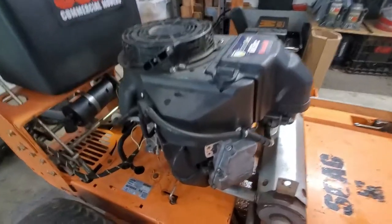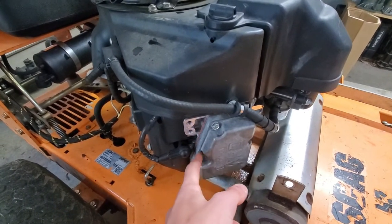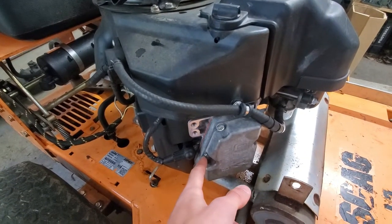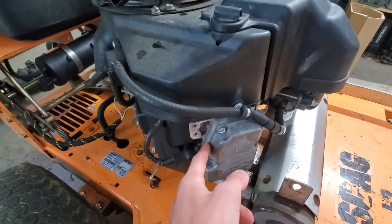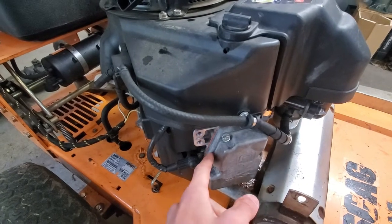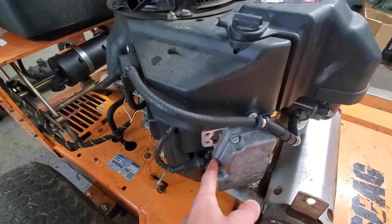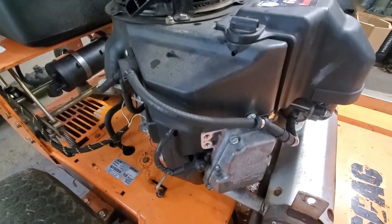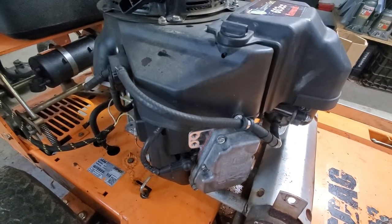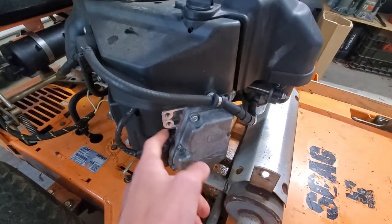All right, so I got that spark plug and cover reinstalled. I used gasket maker, as you could see, but that's just because I don't have a gasket with me here. I already ordered that, but for now we're just using gasket maker. I tightened these down by hand, but I'm going to wait an hour before I really tighten them down because I want the gasket maker to start to dry a little bit. That's the way you get the best seal. You tighten it by hand and then torque it down after an hour. Once the new gasket comes in, I'll go ahead and reinstall that.